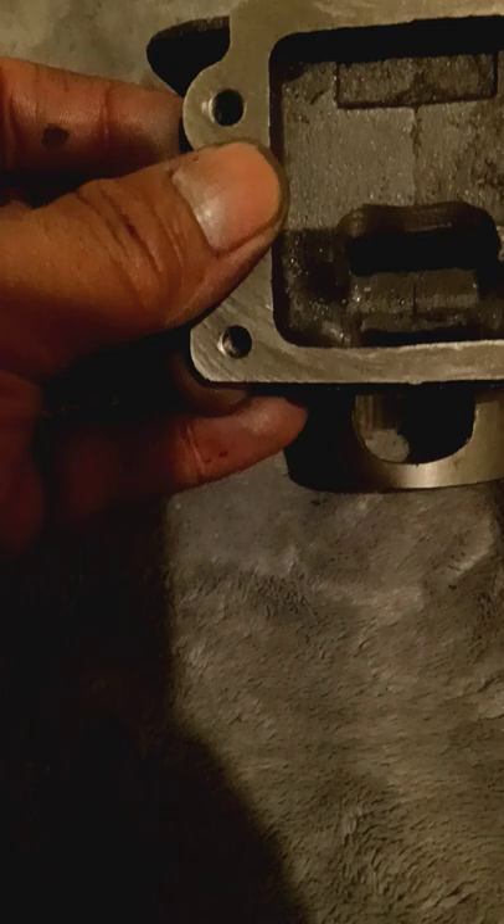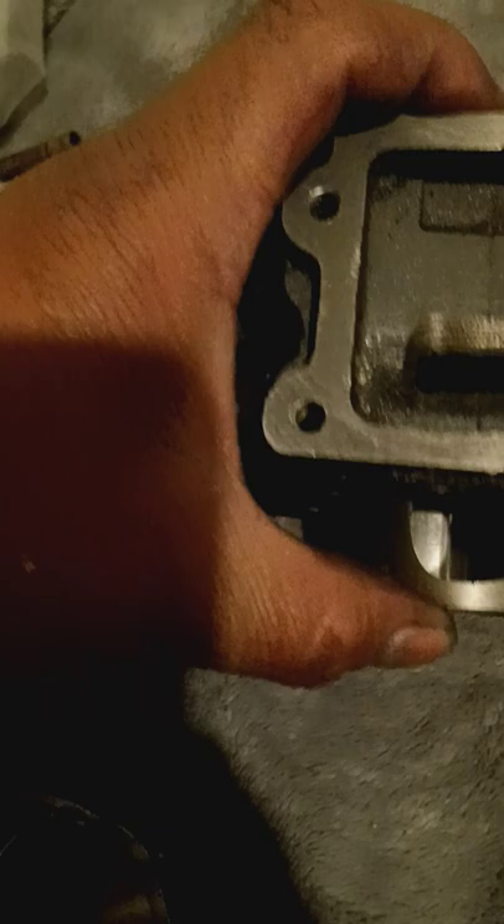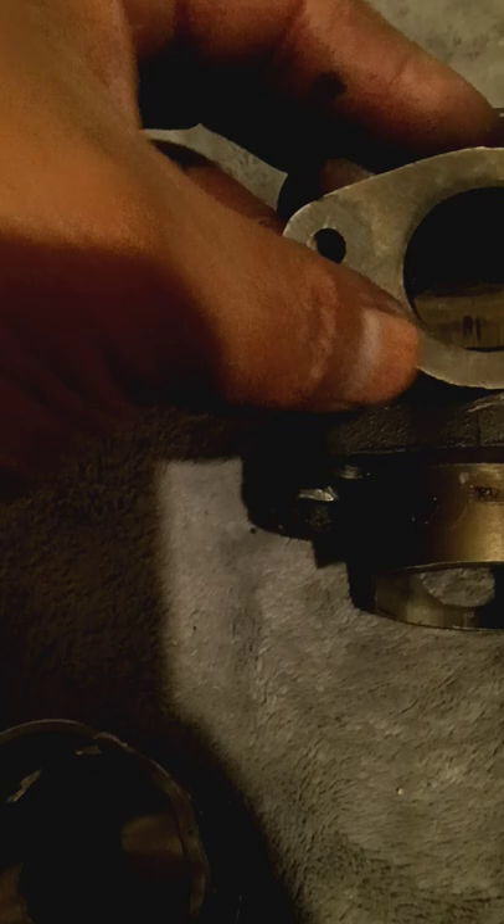I'll do a better video with better lighting. I'm not going to have exact measurements but I could say go about one millimeter wider - a little reference so if you've seen my videos you could be like, okay, thanks for the information. Going one millimeter across here and here with my China cast iron cylinder. This one's not China - it's from Italy - but it's not high quality. I've seen people get the new Raku cylinder and it actually looks uglier than this - the exhaust circle is not as nice. I dremeled mine to have a nicer rounded exhaust to match my exhaust flange.